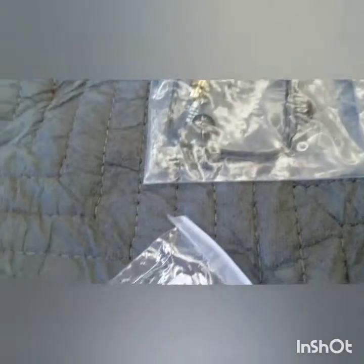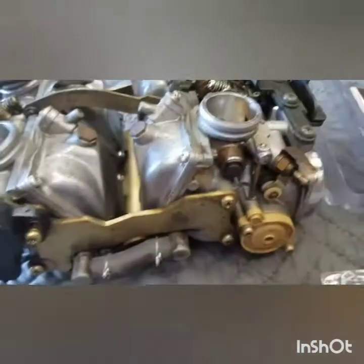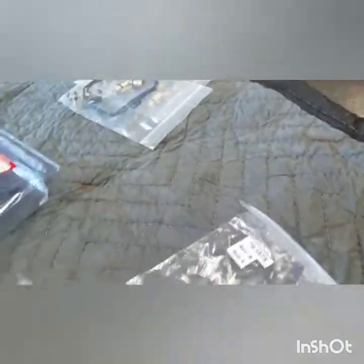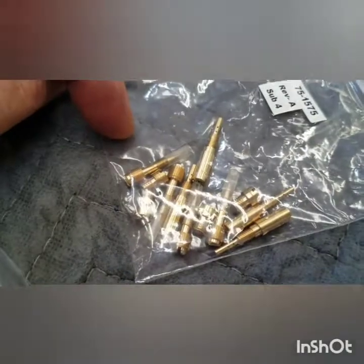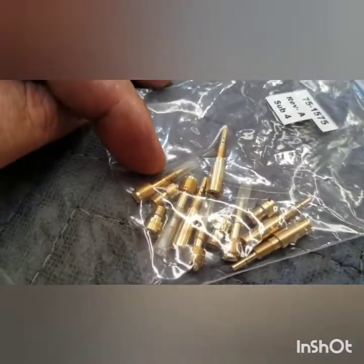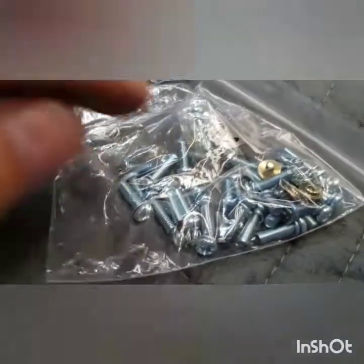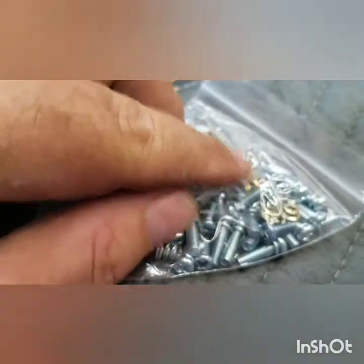This is a more affordable kit. In reality, that's all you need most times - new needles and seats and float bowl gaskets. You've got to take these apart to do anything to them, so you always want to put new needle seats and gaskets on the float bowl no matter what. The All Balls kit has a new main jet, new air screw, fuel-air mixture screw, new slow jet or pilot jet - whatever you want to call it. There's all your screws, including the little screws that hold the float pin in.